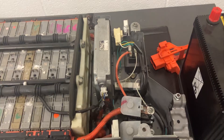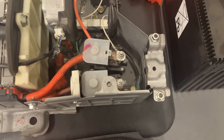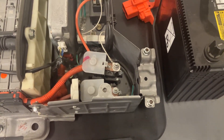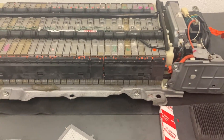The ECU is monitoring the delivery and performance of the battery itself. Then down here what we've got are high-powered relays. Those relays are the switches that allow the voltage to come out of the hybrid battery and up towards the generators and the wheels.